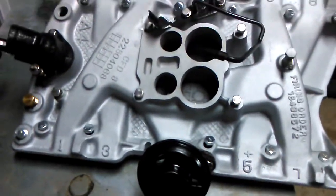At this point we call this an unheated intake. Cold is better — your volumetric efficiency is going to go up if you take the heat out of the intake manifold. Now for stage three, we're going to go over to my other bench, because you can actually prevent the exhaust gas from coming in at all through another method.